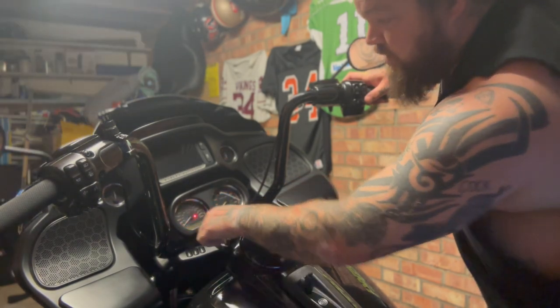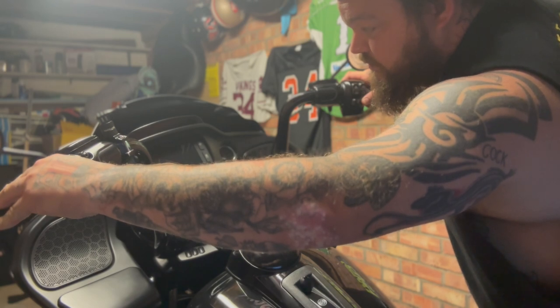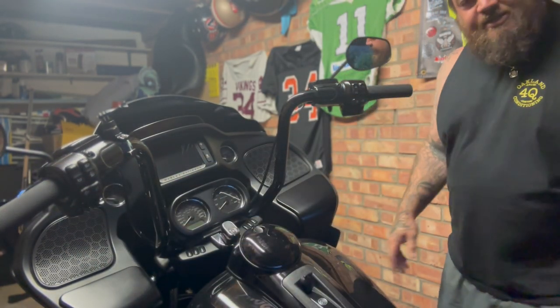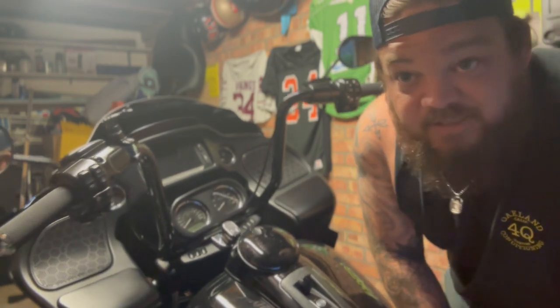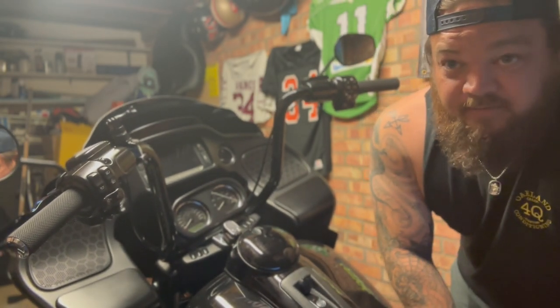Let's give it a go. It's on — security light off — both indicators. One, two, three. Three flashes means it's in transport mode, it's ready to go. That alarm will not go off. It doesn't matter how much you rock the bike or give it the beans — it's in transport. You're good to go people, start your road trip.